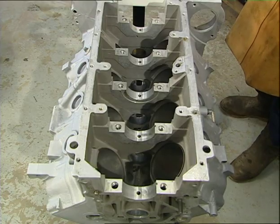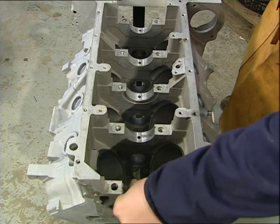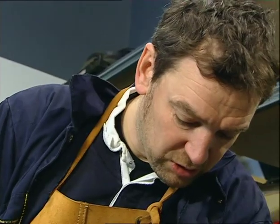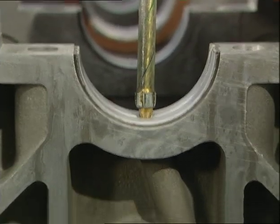The rights were bought from General Motors and at that time it was called a Buick 215. The Americans didn't like the aluminium blocks because they prefer good old cast iron, but their loss is our gain because this is a fantastic engine. In here in the aluminium go some new bearing shells — they've got little locators on them so you know you've got them the right way around. The third one's really interesting — it's also got two thrust faces on it on the side, which are this copper colour, and they're to take up the end float on the crank.